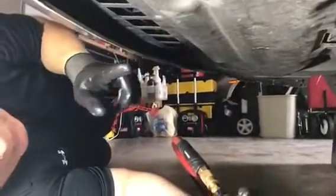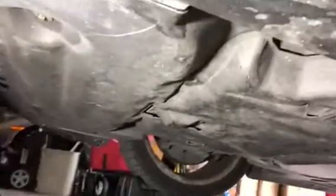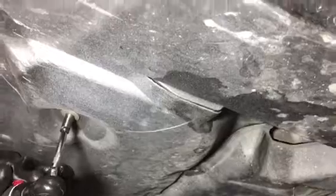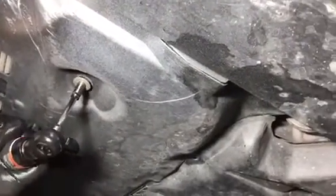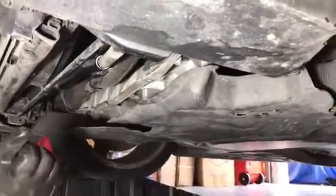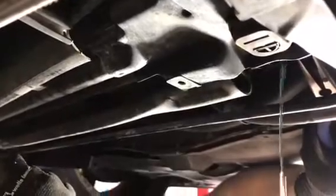So we are doing the first step, after jacking and all this, underneath, first step, which is removing the cover. It has 6 bolts, 2 in the back here, 2 others here in the front, and 2 others here in the front. Okay? Just by removing them, you'll see that the cover can be removed as such. Right? Now we have access to the valve. So after removing, unscrew the piece that was stuck inside, the drainage begins, as you can see from the radiator.